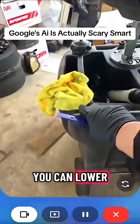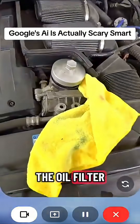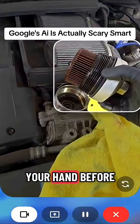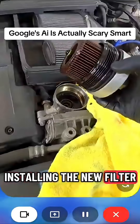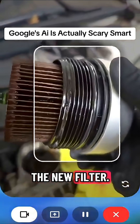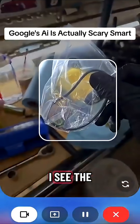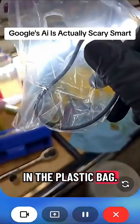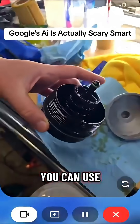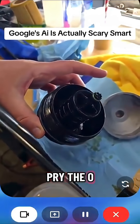Now I'm ready to drop the car. You can lower the car, and then we can focus on the oil filter. I got the oil filter removed now. I see the old filter in your hand. Before installing the new filter, you'll need to replace the large O-ring on the cap that comes with the new filter. There's also a smaller O-ring at the tip of the cap that should also be replaced. I see the two O-rings in the plastic bag. Go ahead and replace the ones on the filter cap. You can use a small flathead screwdriver or a pick to gently pry the O-ring off.